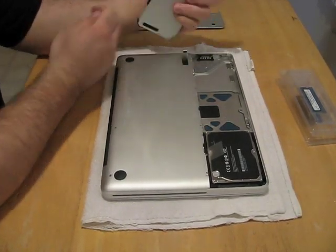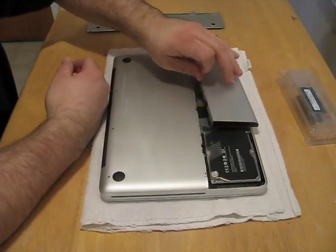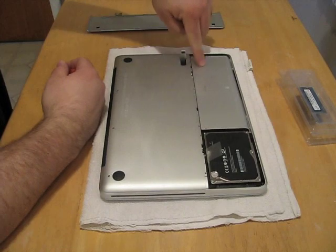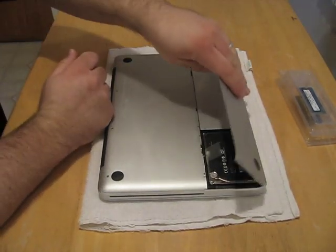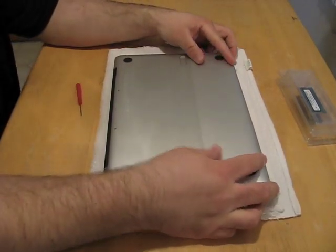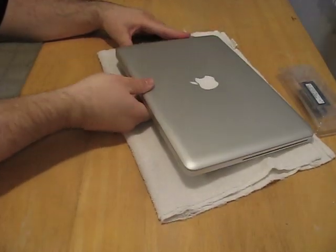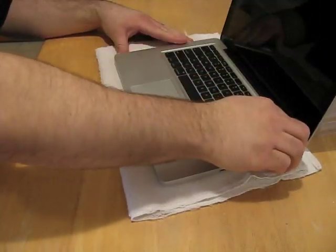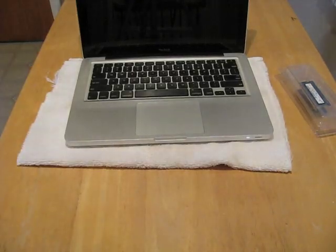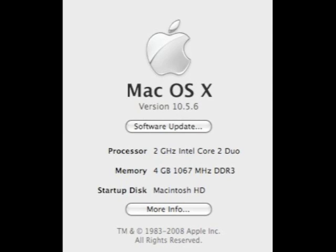When we put our cover back in, here's the battery — the battery goes this way. There we go, clicks down right there. This is going to sit right like this. So we're back to the case it was. Make sure it starts up okay — this is the first time starting it up with that RAM in it, so let's see what happens. And there it is, no worries.